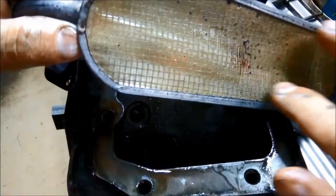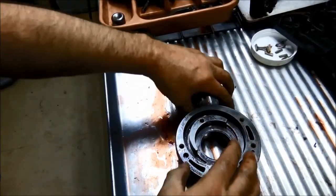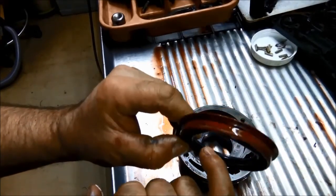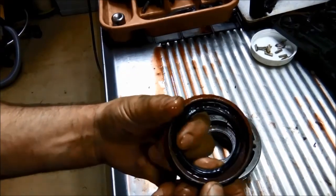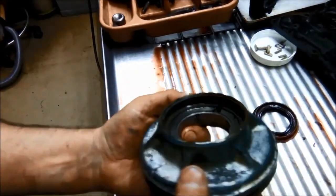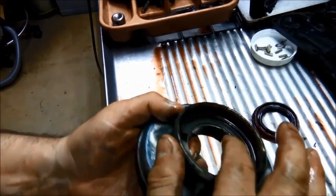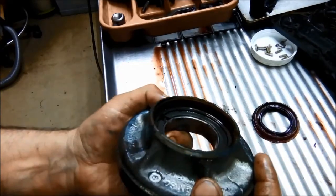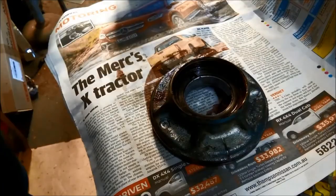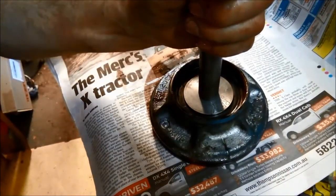There's a fairly coarse filter screen in there. I've tapped out the front pump seal - not too bad, it's got a nice sharp edge and it's flexible so probably wasn't leaking badly. But we need to knock the bush out - you can see it's been munched up. Probably whoever was installing the torque converter hit that little lip and knocked a bit of the bush off.